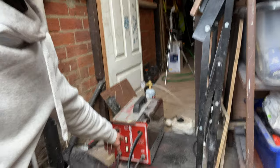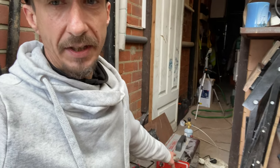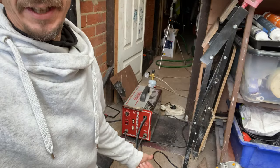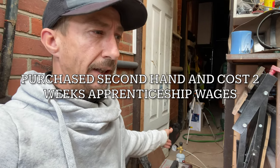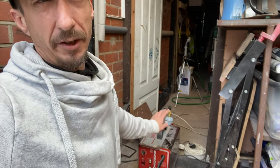I'm not making excuses. The reason is I've had to put the welding machine up to maximum setting - but on the lowest setting of maximum. Absolute nightmare to set up this machine. I've had to put more heat in because on the low amperage I wanted to use, it just wasn't doing anything - it wasn't getting hot enough to even melt the thin sheet metal. The rod wire would just pile up and you could just break it off with pliers. I've had that machine since my apprenticeship - I think I got it when I was 18 or 19, so over 24 or 25 years.